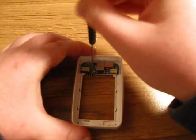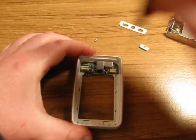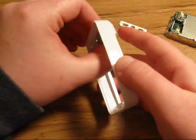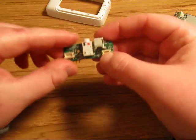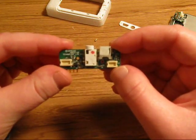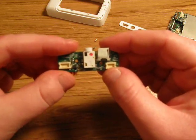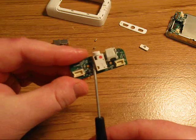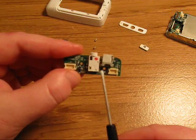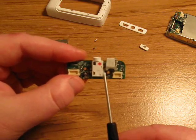You'll need to unscrew the daughter board from the casing and remove the metal jacket. You'll then see the daughter board, which has the headphone jack and the battery terminals. The headphone jack is a surface mount component connected by four legs soldered onto the daughter board — two legs on the left side and two legs on the right side. One or possibly more will be loose, and you'll need to apply solder and re-solder those legs.